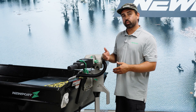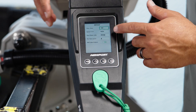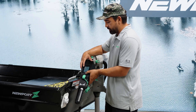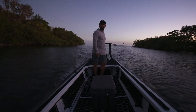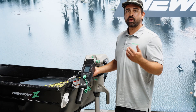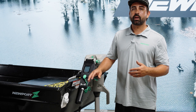Peak performance has a lot to do with the digital screen settings. To access the menu, I'm going to put the motor in park and double-click the menu button. I've got the time zone set where I want it, but I'm going to cycle down to Speed, then Max Power. This setting allows you to maximize range — for example, if you had max power set at 2000 watts, full throttle wouldn't consume as much power as full power mode at 3000 watts. The max power setting is great if you have the NT600 on a smaller, lighter boat or a less experienced user at the throttle.